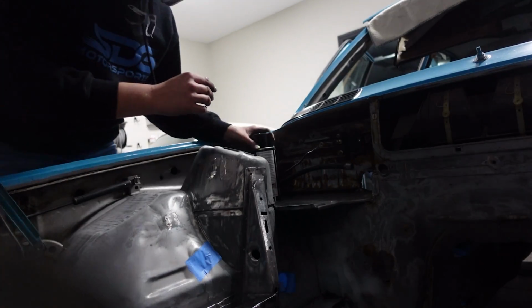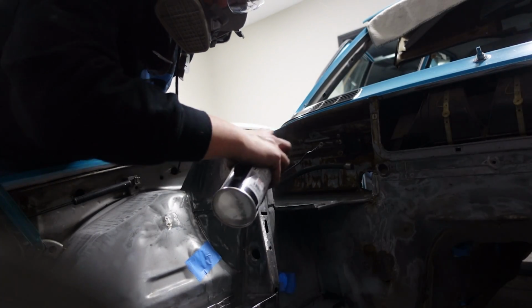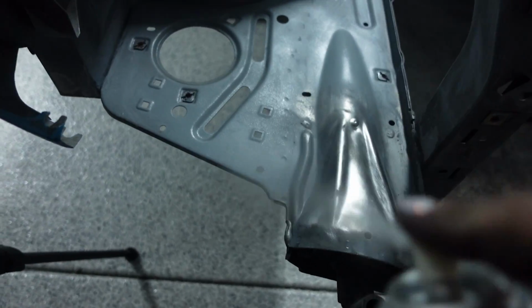This is so that there will not be any bare metal on the car or on the panels whatsoever, because any raw metal surfaces that I will not be painting later in the process that are kind of tucked in their own cave in the chassis will actually rust, and they could rust all the way through, ruining your paint job down the road. So this is a good way to protect those places that you will not be able to reach later on.